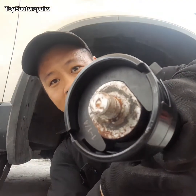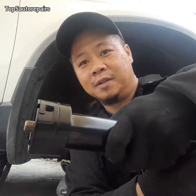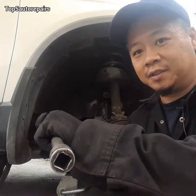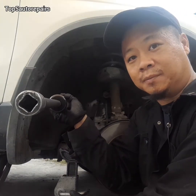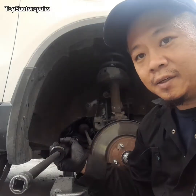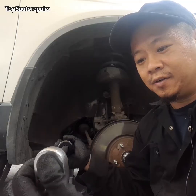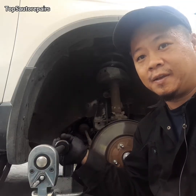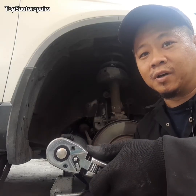As you can see, the tool locks the inner tie rod in place. Next, you want to get a half-inch extension. You want to use a jack stand as support, and then use a half-inch breaker bar or a ratchet — all you have to do is break it loose by going counter-clockwise.